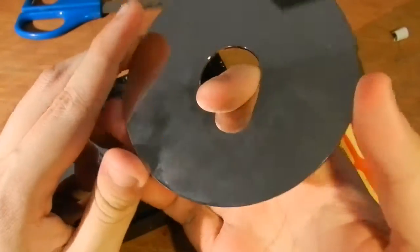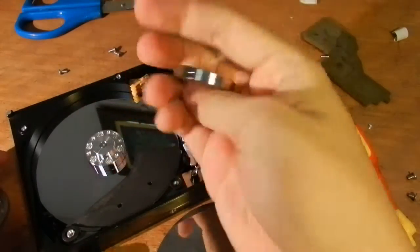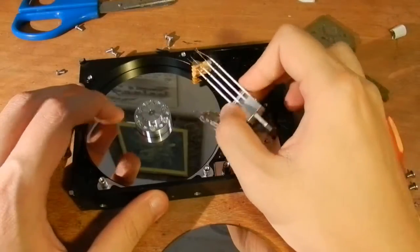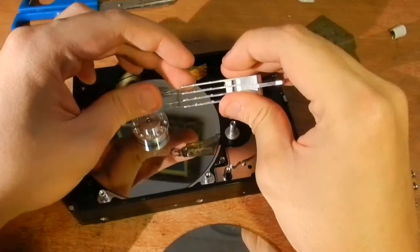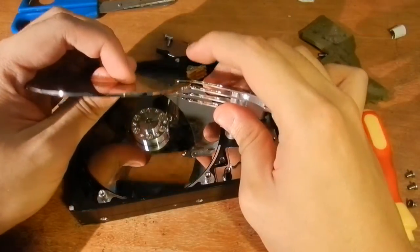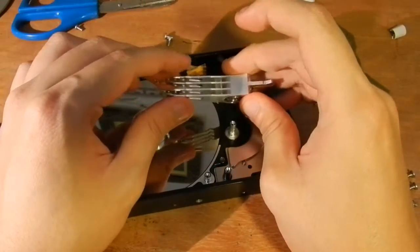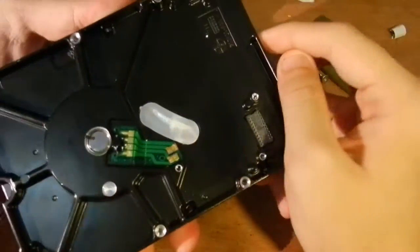If you're doing some kind of science fiction short, you can use this as a prop. But yeah, this is where I had lots of data stored at one point of time. I guess this is a ring to separate the two platters. I accidentally managed to get this head out. So really it is this head that is doing all the work — it is skidding back and forth. As you can see, there are four prongs, even though they make up two heads, gripping onto a platter both from the top and the bottom, reading both sides at once. Everything that has been read goes out via a ribbon cable that goes to the electronics at the back, which I removed earlier.